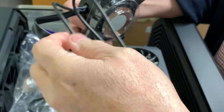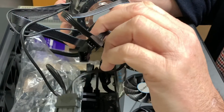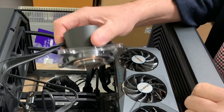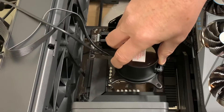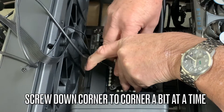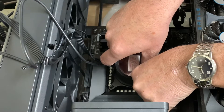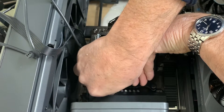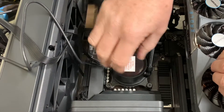The wires that come off it are for the CPU, USB for the fans, and SATA for power. We're going to get this fitted onto the motherboard first — it's already got new thermal paste so we don't need to do any more except get this connected. We'll go corner to corner, and that's all four screws down and tightened up.